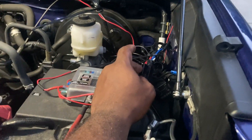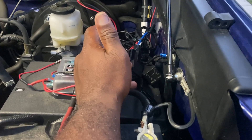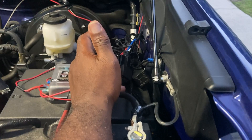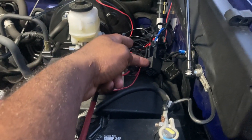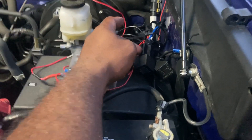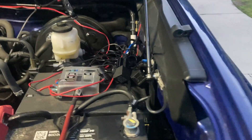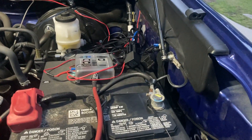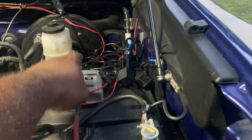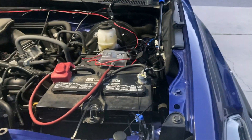Some relays look a little different. This is a cheap relay — you might want to stay away from the bottom price. It was two for like $4.99. This is the relay here, 30 to 40 amp, and then there's another section and the wires snap into metal terminals — I don't know how well they crimped them. That four-pin is for my ditch lights. For this project you're going to need a five-pin relay. I didn't tap into my six-panel relay, so I still have two more sections I can tap into right here.